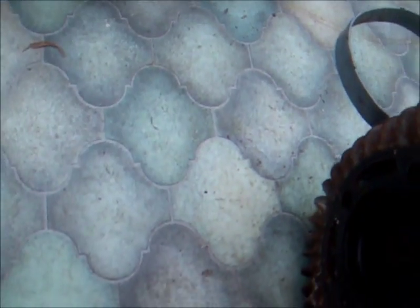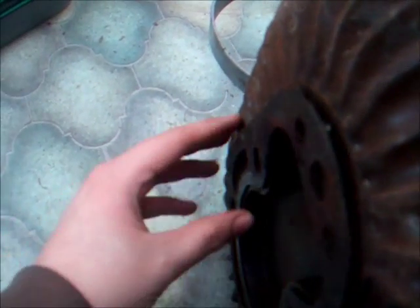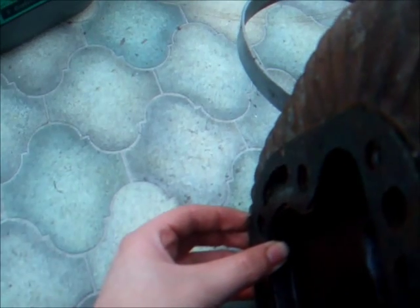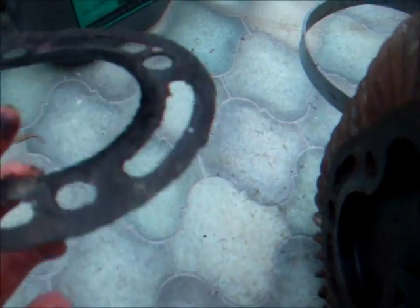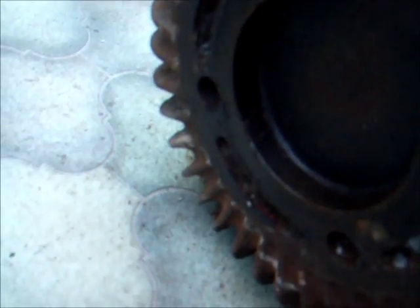I haven't actually looked at the underside of the cylinder head yet. The head gasket appears to have come off in one piece. Might be able to reuse that for a simple test to see if it'll fire, if I can get it off now without breaking it. I might be able to reuse that just to see if it'll fire when I get the governor sorted out.